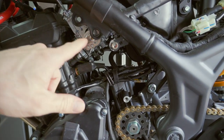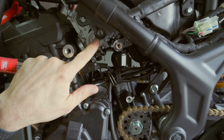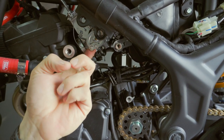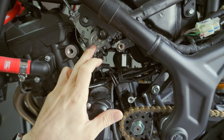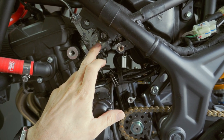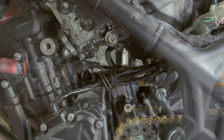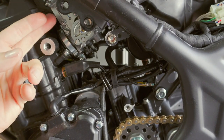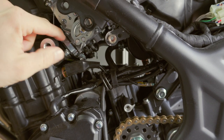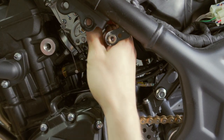You can see the cam and the nut. What we want to do is loosen up this nut and after that we will be able to remove the cam, remove the spring, and reinstall the new one. Before you do this, make sure that you either take a picture or remember how this cam goes back on, because you want it to be the exact same way once you reinstall it. Because I've loosened up my cables at the top and they are unhooked from the throttle tube, these two cables are now loose and can be easily removed, so you don't have to undo that bracket.